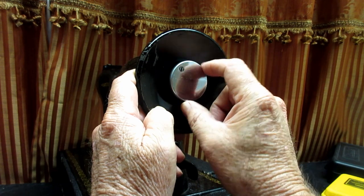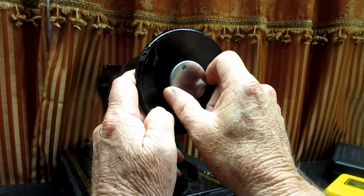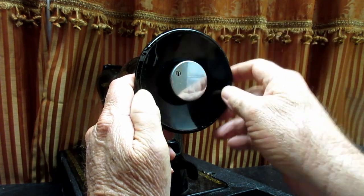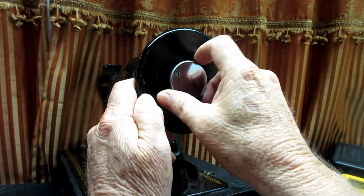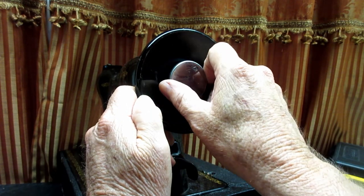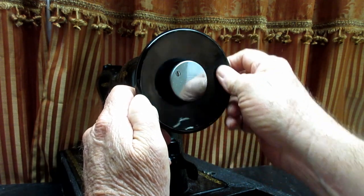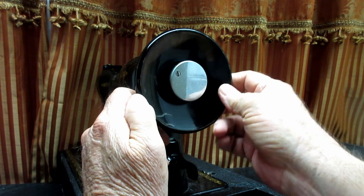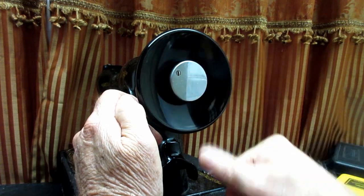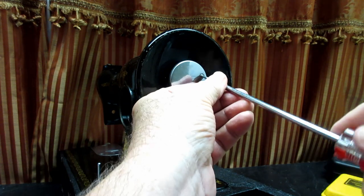That's exactly what you want. If you just loosened it and ran it to wind your bobbin, the whole screw could unscrew and fly off or fall off — that's why they stop it. You loosen it enough to take pressure off that clamp so the needle bar and feed dog don't move anymore, and you can use the bobbin winder.